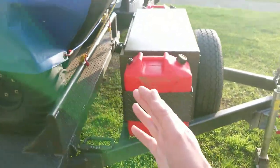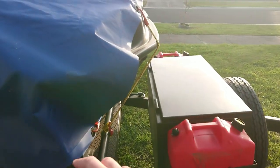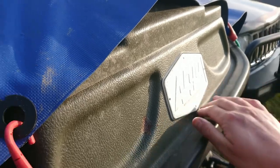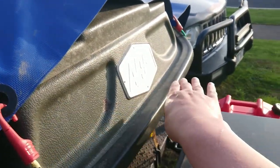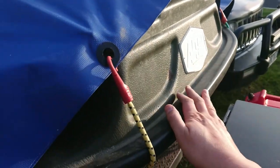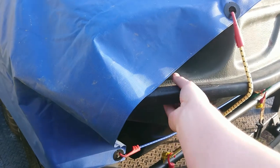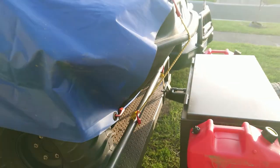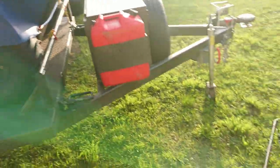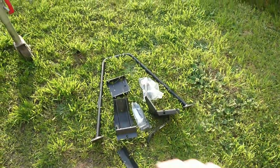We're going to install this. What actually happens is there's a bar that attaches to the subframe on the inside — that big U-shaped one — and it runs up and along behind here. Then a double-plate sandwich goes either side of the logo here, and the winch sits out front. That's primarily to avoid tearing these two sections apart and ripping the Argo to pieces when you're winching.